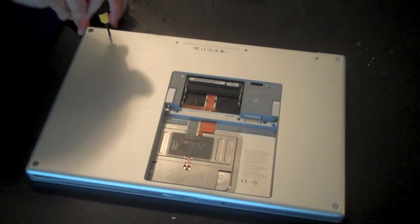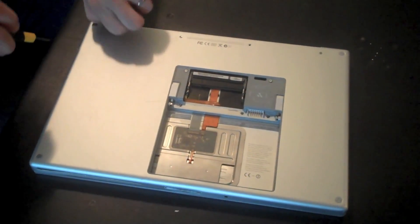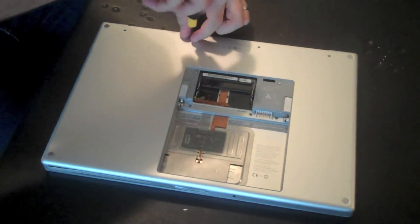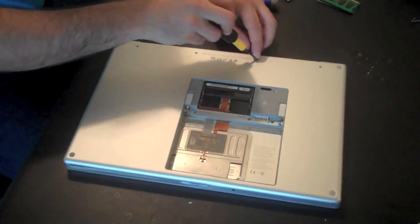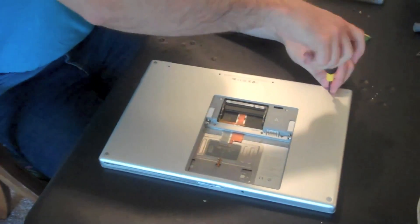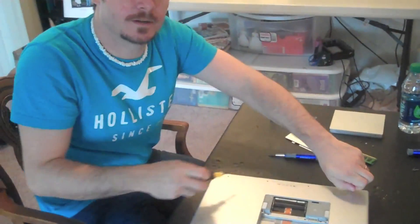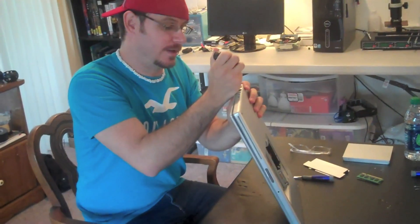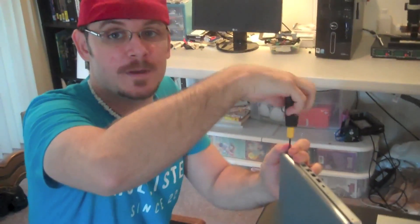With the Torx screws loose, we're going to start taking out the screws from the bottom that hold it in place. There should be a third one here — it's not there. That's fine, sometimes they break and fall out, or sometimes someone else has been to these MacBook Pros before. It's not a worry — just make sure you put all the screws back in that came out, so the client is happy. If there are already missing screws and you don't have them to replace, just inform the client that they're not there.